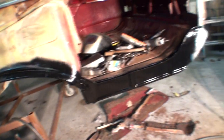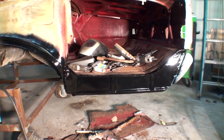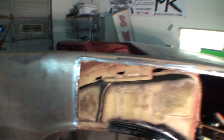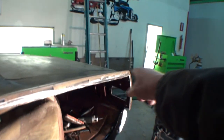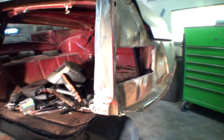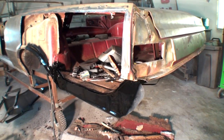That's how the story goes when you're working on stuff like this. I went ahead and applied POR-15 to that because once we put that outer skin on — and you can see I've already got it ready to go — I got my flange already around the edge, I cut it already out to fit, and then we're going to be doing some butt welding right here on this edge and around. Once we get the quarter panel skin onto the vehicle, we're going to have to come back here and mold all this back in.